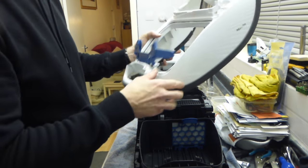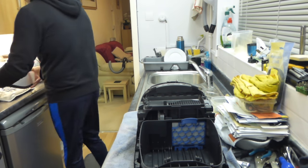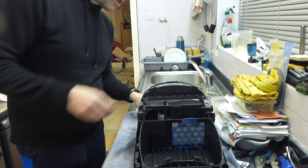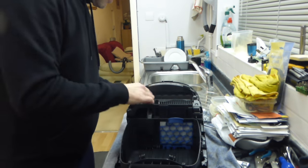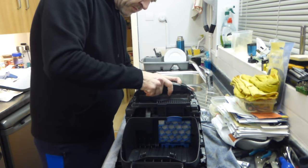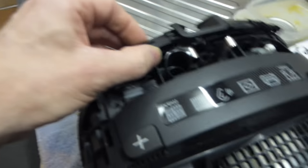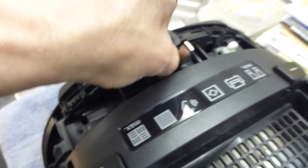You've still got a screw there and still one there, so I'll tip those out now. Now this part here on the back — when you take your deep screw out, that allows this part here to lift up. You need to unclamp it from the side and that part will lift out. It's like a T-shaped part with your little screw in the bottom. When putting it back in, lower it down with the screw in position.